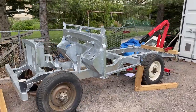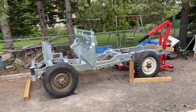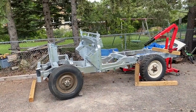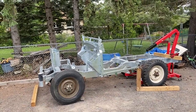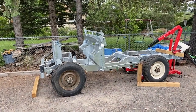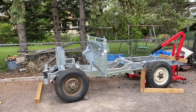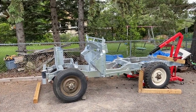So, 1961 Series 2 Land Rover, but we'll do it with a later Series 2A drivetrain. Not all Land Rover Series 2 2¼ engines are the same. In and around 1961 they changed it, and the parts for the earlier one are pretty hard to get. So if you're restoring one of these cars, unless you're dead set on absolute originality — which not many people are on these vehicles — you'll probably want to switch it to a later 2¼ engine.